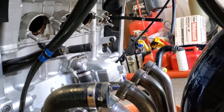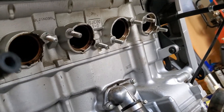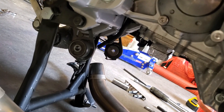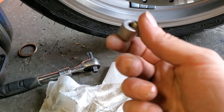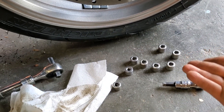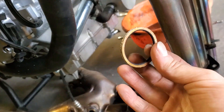The milestones are completed — the headers are dropped down. It's super easy to remove: pull the oxygen sensor out, there's one bolt on each side of the center stand, and then you remove all these eight millimeter Allen cap nuts. One exhaust gasket fell out, not too bad. Now I can get this thing completely out of the way and start doing modifications.